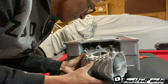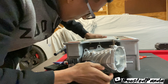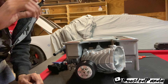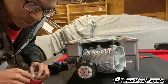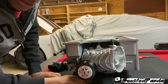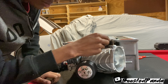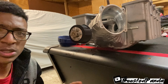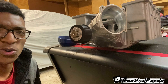After you get your nice seal going, however you want to do it, you're going to go ahead and put your snout on. You might have to spin it a little bit. Once you have it lined up, go ahead and push it on there, get a nice seal going, now put in your bolts. When you get them finger tight, go ahead and start torquing them down. The sequence is: bottom mid, top mid, top left, bottom left, bottom right, top right. The torque back is actually a three pass — you go 4, 11, 22. That's just to make sure you're not cranking it all the way at once. You can kind of do it by hand — just don't over-tighten it and you'll be fine.